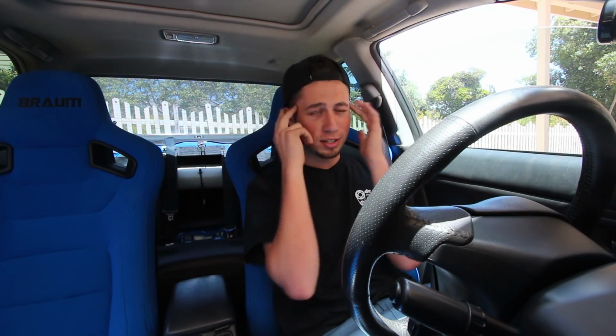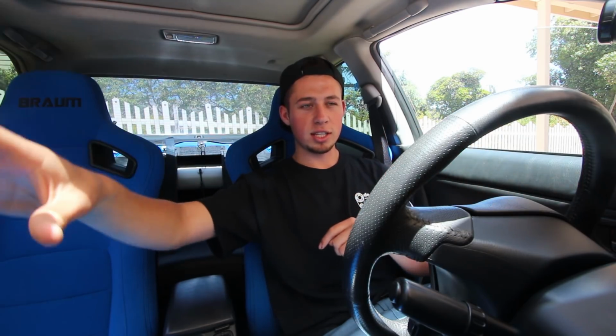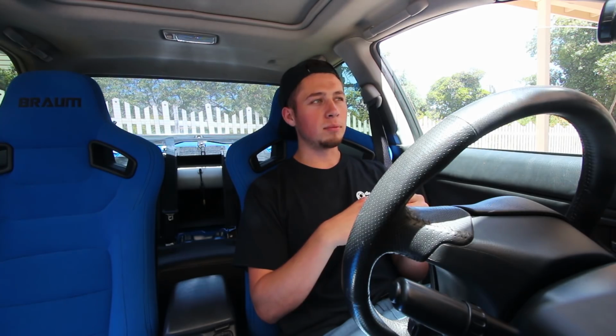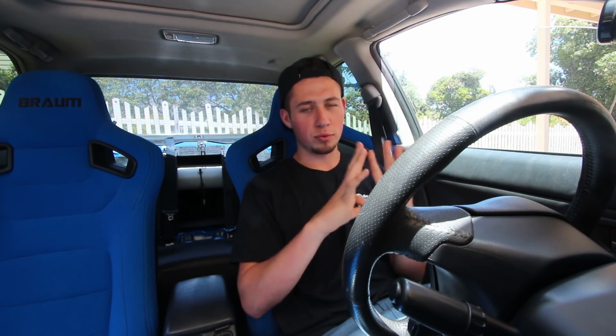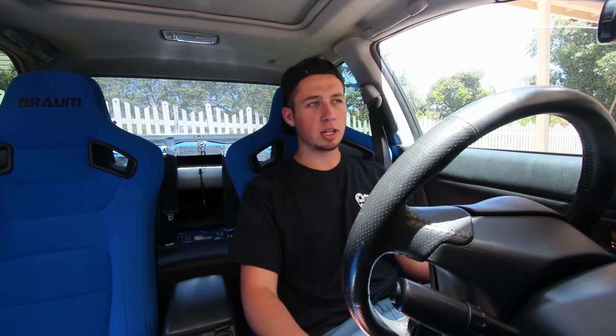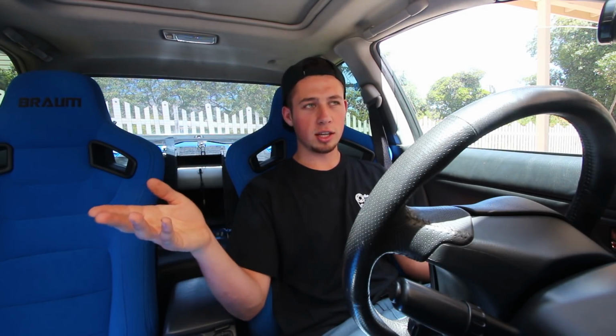It's really hard to explain this. I could visualize it really well. Essentially, it's bad to hold the cam and torque it down for the AVCS because you can cause damage to that locking pin. And I'm not taking credit for this. I was reading forums, and I finally found a guy that seemed very knowledgeable on the subject, and that's basically why they make those tools, so you don't damage anything.